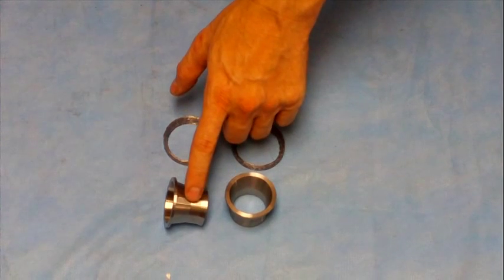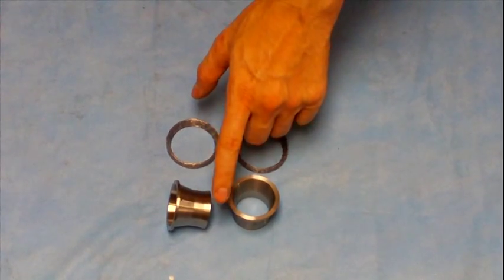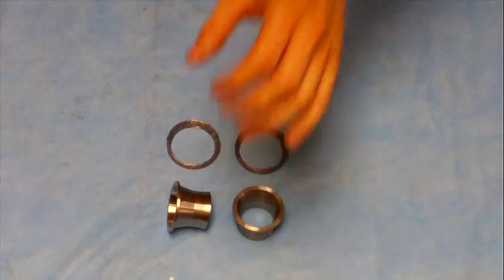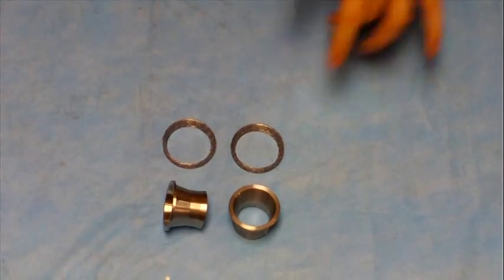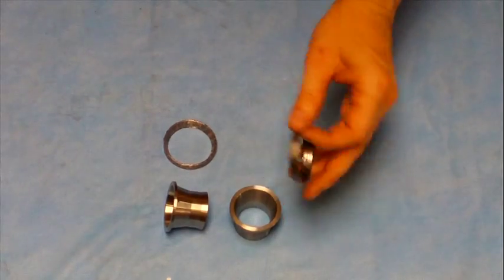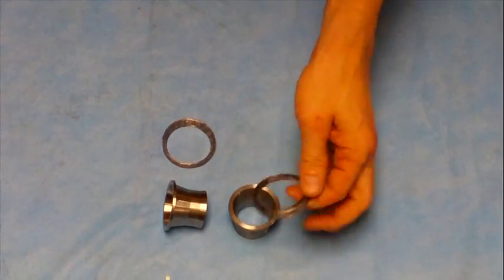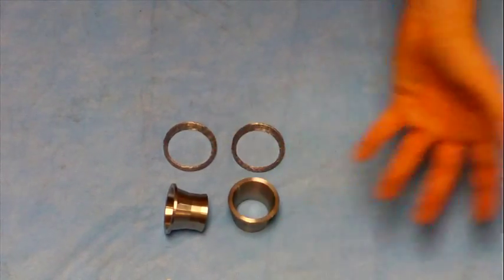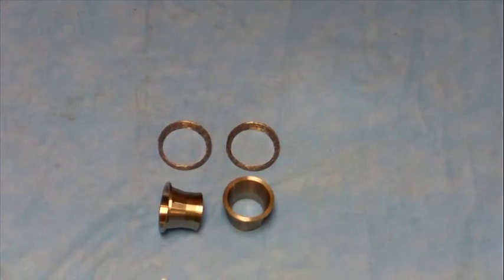What these do is give you a little bit of back pressure on your exhaust, good for that mid-range torque. Really nice if you're using our box pipe without the baffle, these are not a bad idea. So the gaskets go in the engine, torque cone goes in, exhaust cone goes on, and then the retaining kit tightens it down.